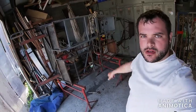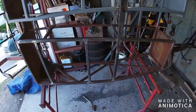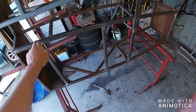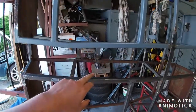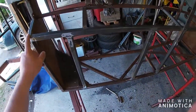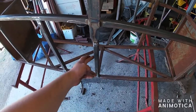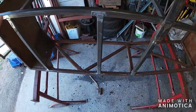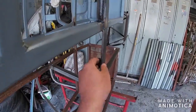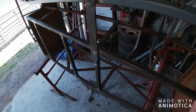Welcome back to episode 6 of Project Low Cost MX5. As you can see, I've got the passenger side floor area in now. This bar here doesn't have a kink in it like this one does, because there's more room on this side - it's wider, so I don't need to worry too much about the seat. It's just easier to put a straight bar straight in. I've replaced the two seat rails and they're all fully welded in. I was going to put a box section but I thought I'd add a flat bar - it'll take up less ground clearance.